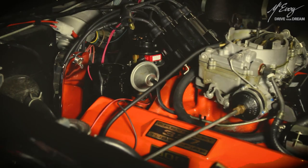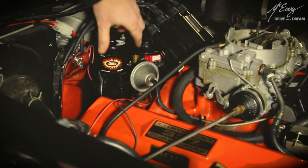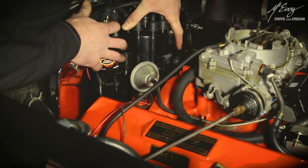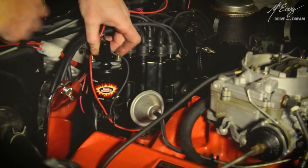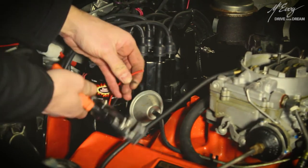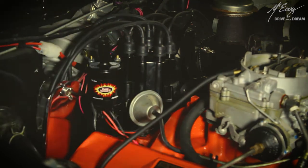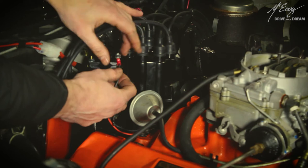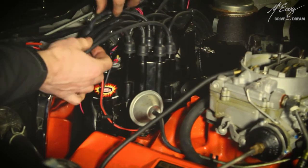This device has a brilliant built-in feature. It senses current levels in the coil and adjusts dwell angle to suit the entire RPM range. Also, the coil is a low resistance fitment, putting out a shattering 45,000 volts. Be careful when working around the ignition on a running engine. You would sometimes get a nasty shock when adjusting points, but that was at half the voltage. This won't be any less painful, surely.